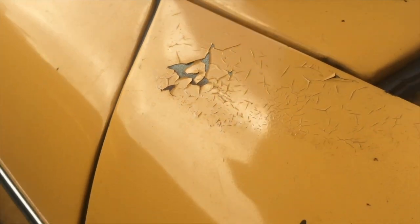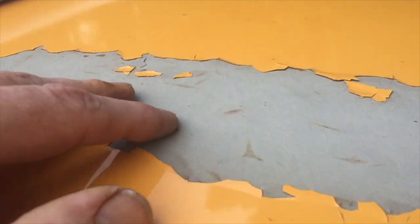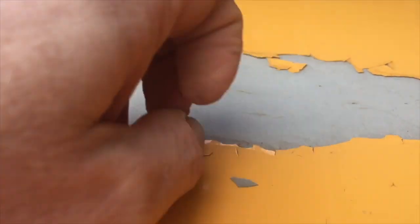there's a number of places where you can see the paint is crazed. I don't think it was originally a very good coat of paint when he repainted it. You can see it's the top surfaces. Our Australian sun is really harsh. The UV is extreme. So it's mainly the top surfaces. You can see along the front fender here on top, but also particularly on the roof, there's a few areas of cracking, and in the middle here we can see a big patch. The undercoat is still actually pretty good. I think it either wasn't prepared properly, or the paint that they put on perhaps wasn't done quite correctly.